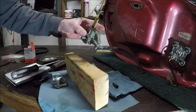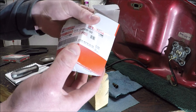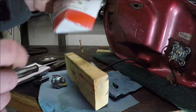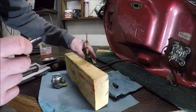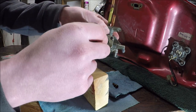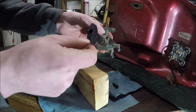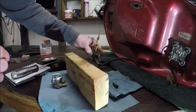All we're going to have to do is put in our new Yamaha one — I think this is off a Raptor, part number 2VN-24500-02. You will lose a little bit of usability with this, as it has a long lever, and I'll show you when it's on the bike. You're going to lose this long lever, so you're going to have to get your hands in there a little further to turn it on and off.